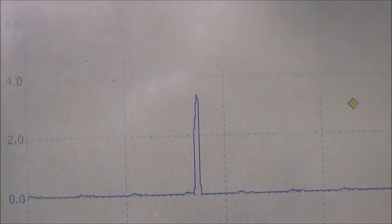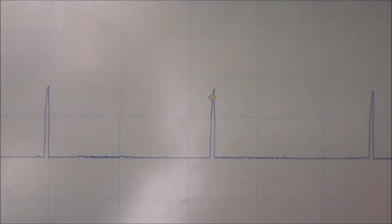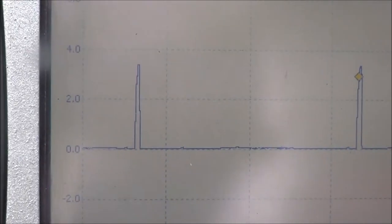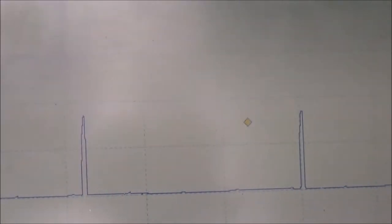Sorry for the bit of a glare. Sun's out today. So I see right now there's an even pattern. Not really a square wave, but we can call this a reference because that's a good working coil. Alright, so right now I'm going to stop this and look at cylinder number one, to see what signal we get.